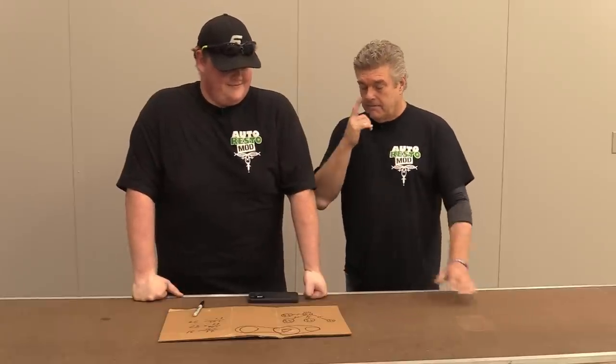That's really basically it, folks. We wanted to show you what to look out for — something you may not think could be an issue on your car. You're just trying to get ratios. I'm not going to tell you exactly which pulleys you need because this applies to anything with pulleys — and it's also about setting up your car for how you drive. If you're doing drag strip stuff, you want underdrive on your pulleys because you're going to be hitting 5,000 RPM a lot. If you're sitting in traffic like this one was built for, you want overdrive.